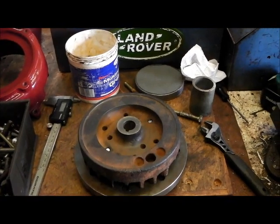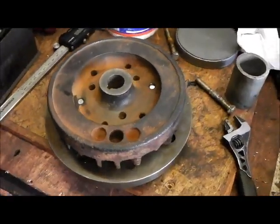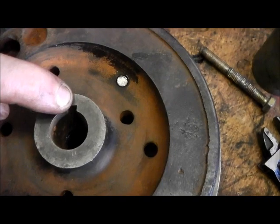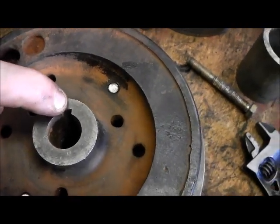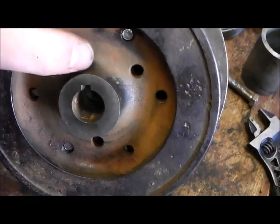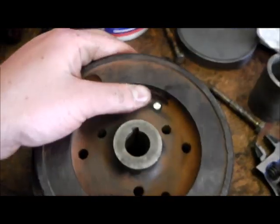Hi folks, we're working on a JAP engine again and another little issue I've picked up on, really just cleaning up the last bit. Now the flywheel - you might be able to see by my fingernail there - is what looks like a small crack. It looks like it may even just be a casting flaw where a crack has developed. It doesn't go very far at all, a couple of millimeters.